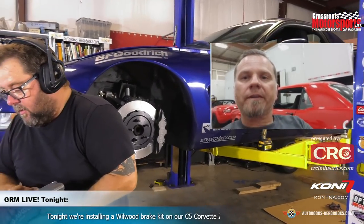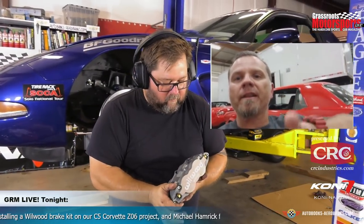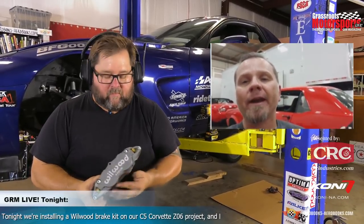So keep in mind that particular rear caliper is designed so that it can be a left or right hand mount. So once the caliper is mounted on the left or right hand side of the car, we're only going to bleed the bleeders facing up. And on that particular Superlite, what we'd want to start with is the right rear of the car and do the outboard, then the inboard of the caliper, and then kiss the outboard one more time to make sure that we've got all of the air that may be trapped in that caliper out of it.